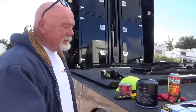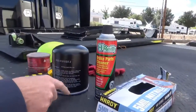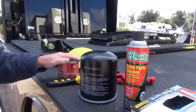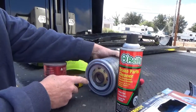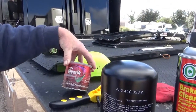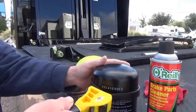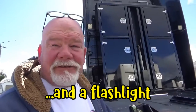What we need is nitrile gloves, a little brake cleaner — because once you take this off there's probably going to be some dirt and sediment around where it attaches, and you want to use the brake cleaner to clean that off. Some grease, because when you put this back on you put a little bit of grease around this ring and o-ring. High temp multi-purpose grease. Then you need a rag strap wrench — at least a six-inch strap wrench — and a bump cap, because I know I'm going to smash my head down there.